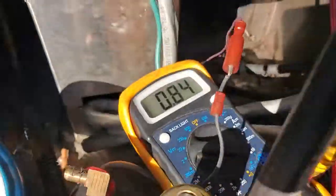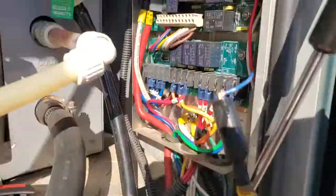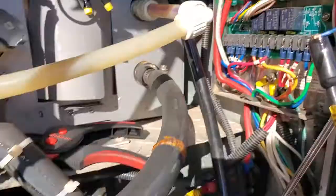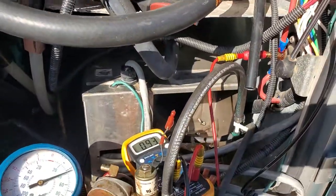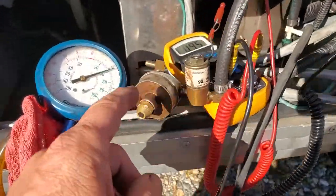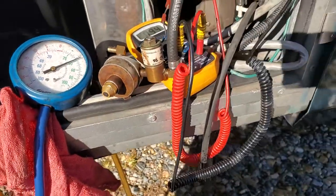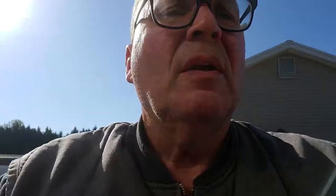So about 6 PSI, about 0.87 amps — that's how much you're supposed to get. That was the blue wire, just like I showed you. Now we're going to take it all apart, combine it together to where we get air and fuel coming through the solenoid, and we'll see the spray pattern. You know how to test each individual component. We'll even check the amp draw of the solenoid — kind of important, kind of not. I'm going to shut this off.